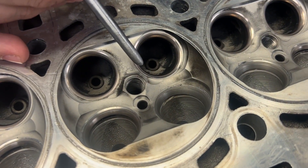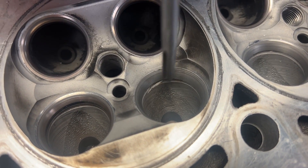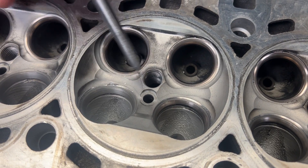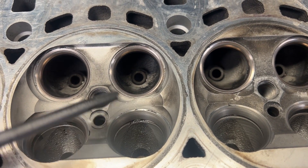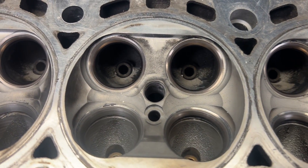First thing I noticed was the same individual that worked on the last S58 head we showed you. You can see under here they pried the valve seat out and put some junk in there. On this one, there was some material missing from the back side of the seat — looks like they took a screwdriver and hammered the valve seat out. Just a bunch of neanderthals. The valve job is different on all of them. There was so much wrong with that cylinder head that we just scrapped the idea — we're not going to put that on his car, and we came up with another head.